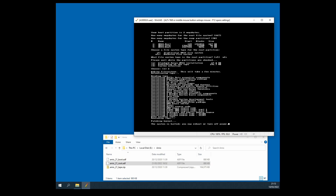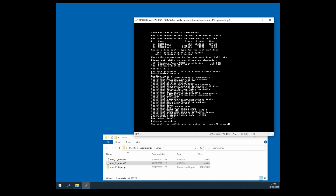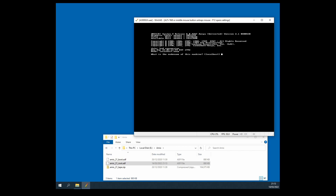'System is halted — you may reboot or turn off power.' Before I do that, I need to eject my floppy drive so it doesn't try to boot off that. Then hit keyboard reset and wish me luck. We're rebooting off the hard drive — excellent. Unix has come up almost instantly. It says 'date bad conversion' — don't worry about that too much. That's the year 2000 bug. Yes, the Y2K bug is still around — this software was written 30 years ago in the early 90s.